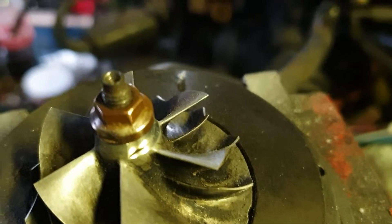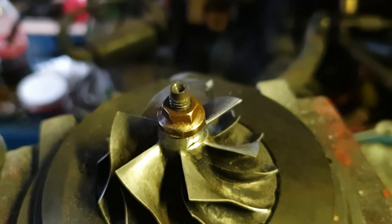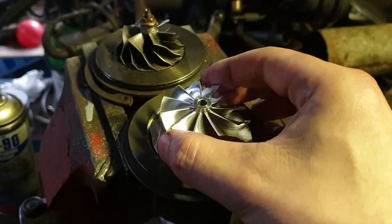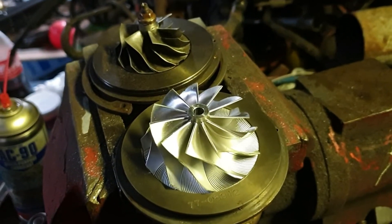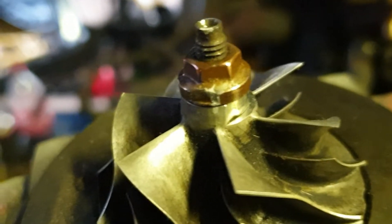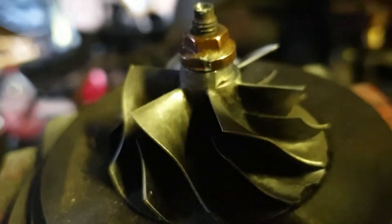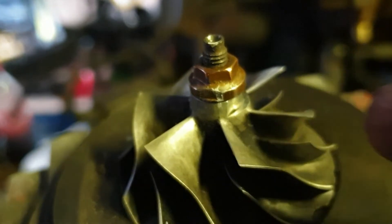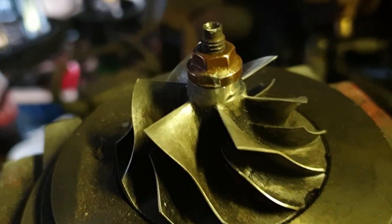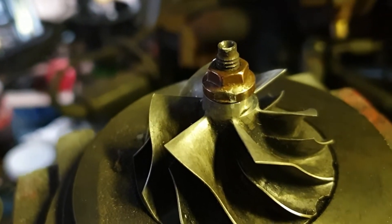My application is slightly different — I just want the shaft and turbine out of this to fit into this machined TD04 so I can attach it to this billet 20T. The shaft, nut, turbine, and compressor wheel all have to be synced up when putting it back together so you don't lose your balancing. Never forget with these: left-hand thread. Don't make the same mistake I did the first time — going the wrong way and busting the shaft in half. That was many years ago now.